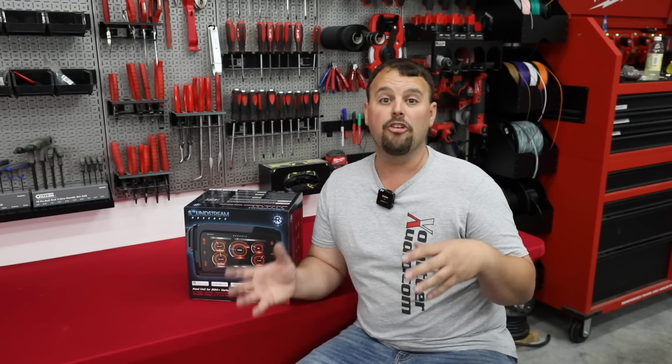Now, there's another issue I want to address. Some 2014 model bikes have an issue with data clashing that's causing the security system to come on and the bike doesn't start. They've traced it down at iDatalink to something to do with the speedometer and the instrument cluster. They're working on a revision to fix that, but until then, this exact same process that I'm going to show you, where you enable your gauges to only connect to the OBD2 on demand, fixes the problem on those 14 models. I'll go through the process.